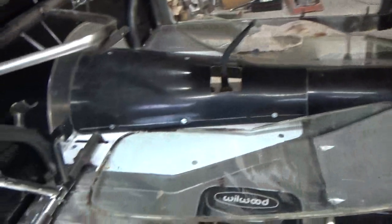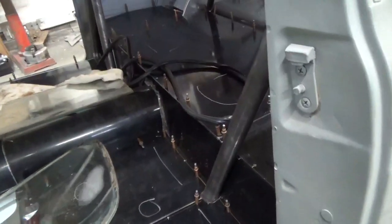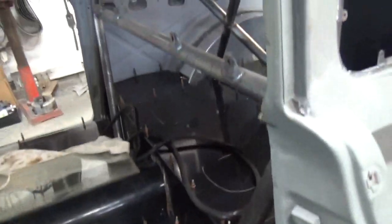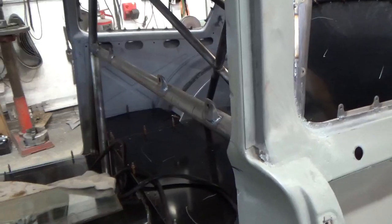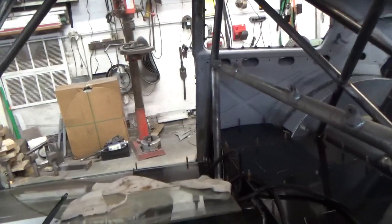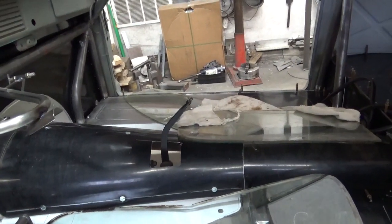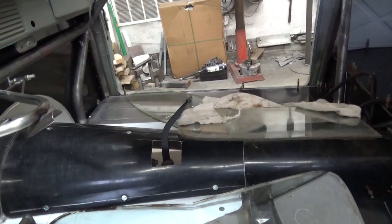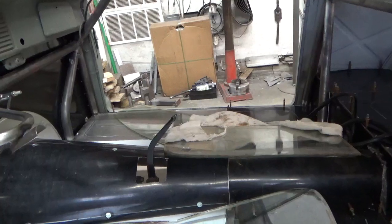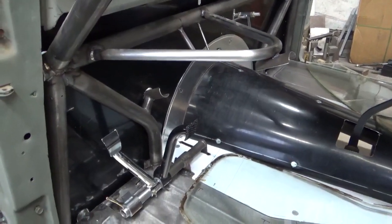The floor platform from the firewall up there to back here — it's like 47.5 inches — but with the curved back brace I ended up at 49 from that bar to the firewall. Just gives me enough room to get the driver in. With the shifter there, you've got to be where you can reach it. If I slid the seat back farther, it would have made that difficult. It might have helped a little for pedal clearance but you never want to be straight-legged in these things.